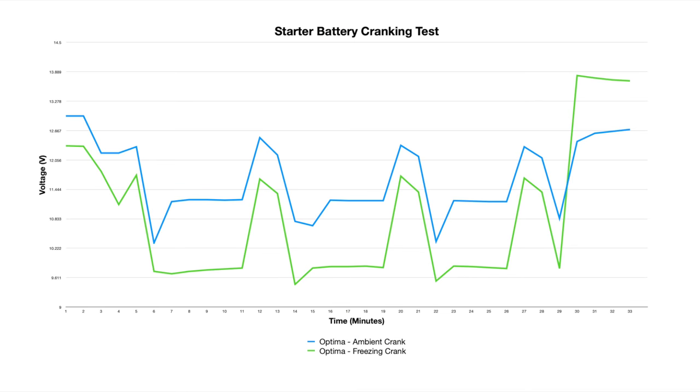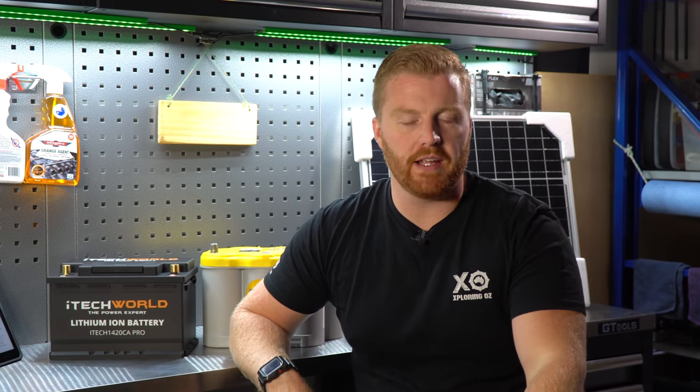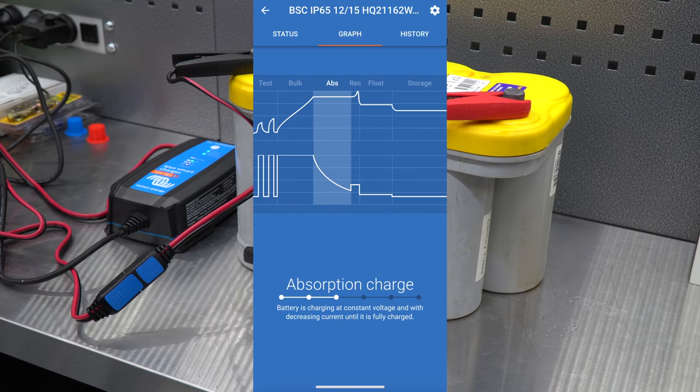Starting with the Optima: freezing the battery reduced those fully charged resting voltages from 13 to 12.4 volt, and adding a load appears to have a greater effect on the frozen battery, bringing the voltage all the way down to 11.1. The pattern of the voltage drops is identical, but the frozen battery runs at a much lower voltage compared to its ambient temperature test. While under load, the frozen battery is 1.4 volt lower in the same circumstance, and while under low load with the ignition on we're about 0.7 volt lower. When the engine is started on the fourth crank, the charging voltage is much higher with the frozen battery. In summary, the AGM had no problems turning over the big V8 and I'd be fairly confident using it in cold weather situations, and there's no problem with the battery accepting a charge at these cold temperatures.